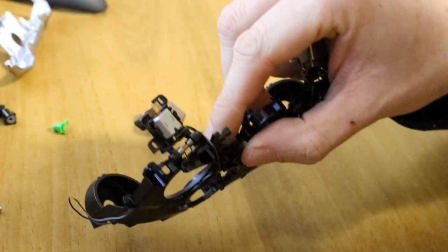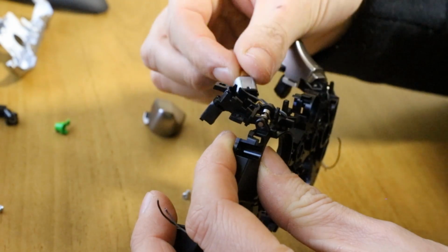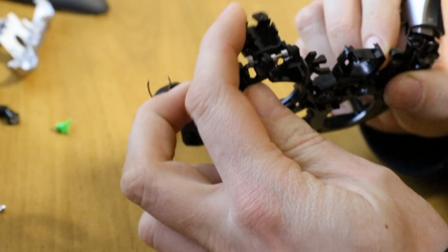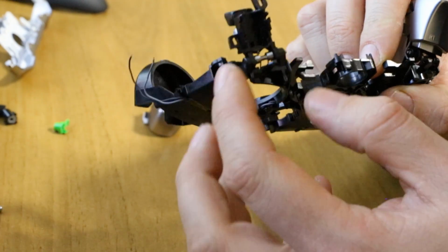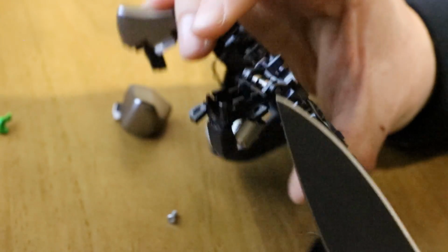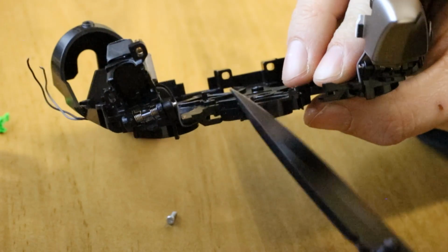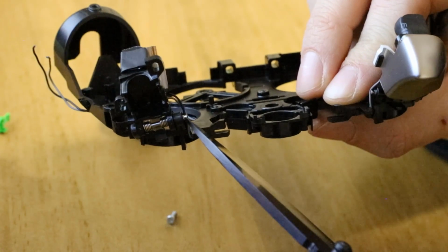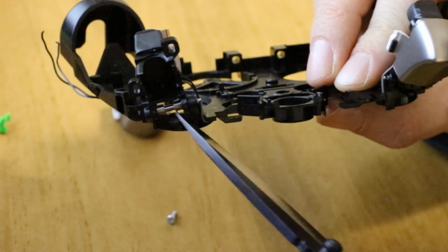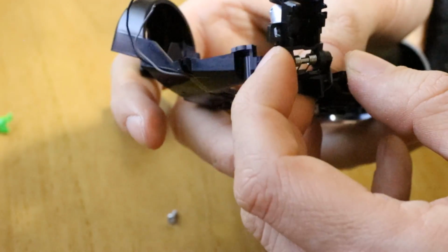And you'll see if I turn it round, there's your motor and the trigger that just sits in the cradle. And there's the motor. This cradle, you can technically get off. You'll see there's a spring here, and that's what's giving this spring action. Now the issue with these is, see if I can zoom in and get a good image for you. There's the bar going through, and it goes right the way through there and holds a spring in. And the other side, you've got like a knurl that's keeping this bar in place. So it's going to take a lot of force to push that bar out. I believe it's pressed in at manufacture.